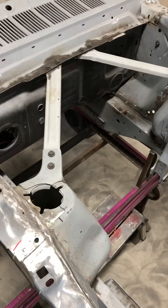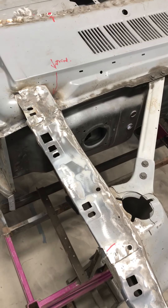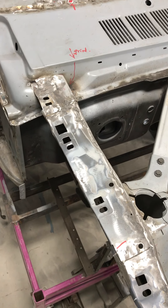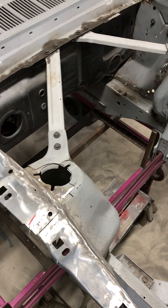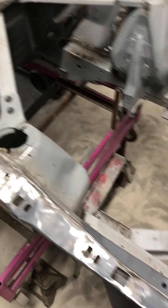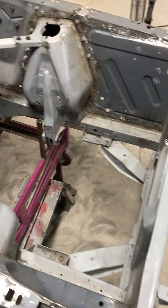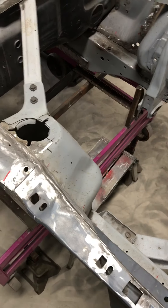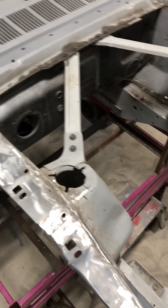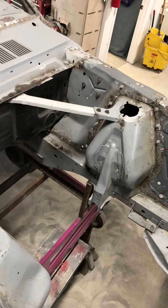So what I'm going to do — I'm still welding on the car because you've already painted your fenders and stuff. I'm chipping them and making problems on the new paint. I'm only going to put those on when I need to. I've already put them on once, but I'm still doing all the metal work, so I don't want to get sparks and stuff on it, especially your hood. So they do go on, and when you get back here, you'll see them all together.